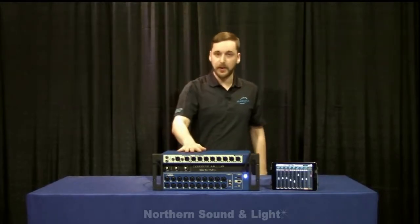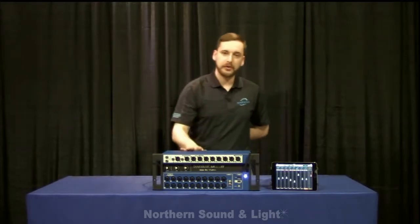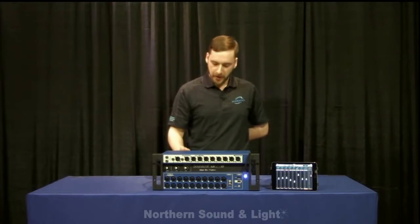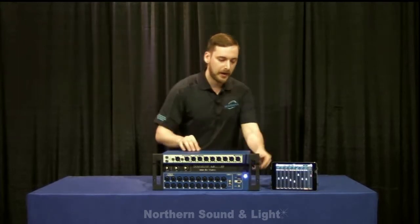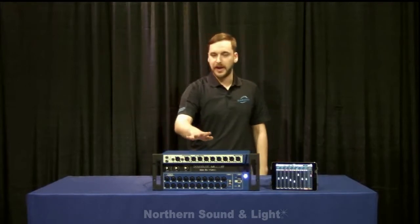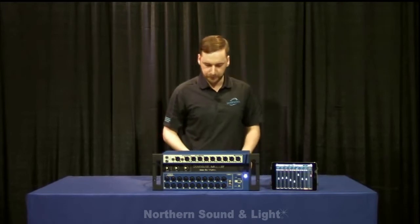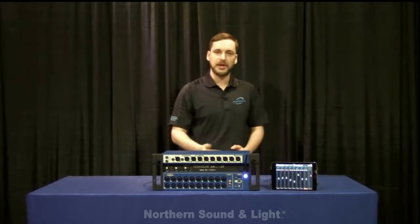Connectivity-wise, you can have up to 10 devices connected at a time. The beauty of that is you don't need an app — whether you're using an iPhone, Android phone, Linux computer, Blackberry, anything you've got, you don't need to worry about keeping anything updated. It's all HTML5-based. The simplest way to connect is to use the internal hotspot; there's one antenna on the front and one on the side. You set it to run on either a 2.4 or 5 GHz network. I typically like the 5 GHz network because there's a lot less congestion, especially in a crowded space. It's always best to use a Wi-Fi scanner when setting it up to determine which channel will have the least interference.